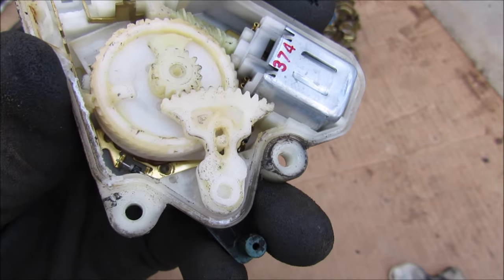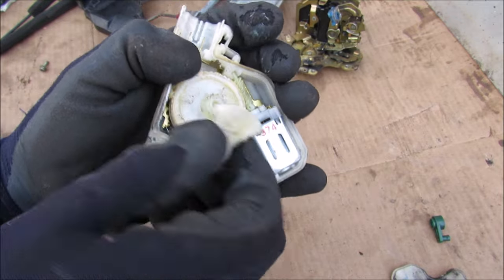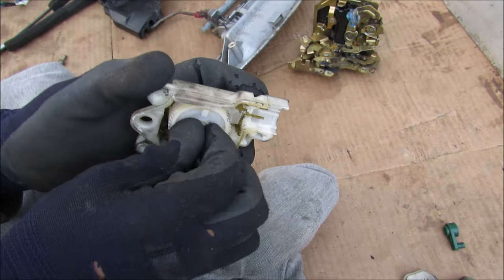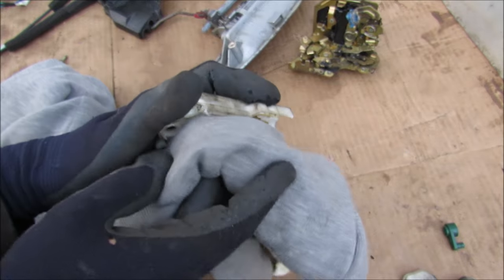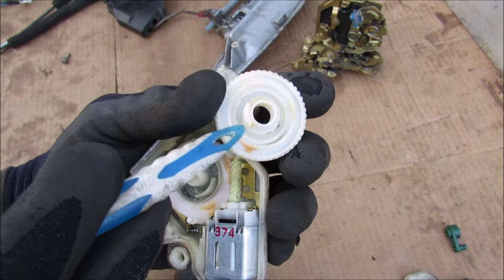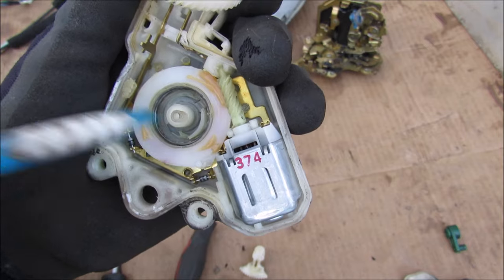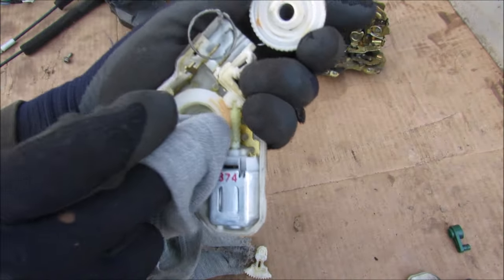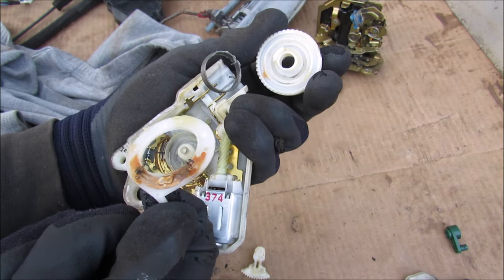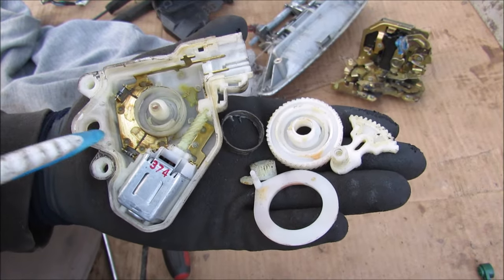Removing the screw holding the actuator, I can pop off the arm and pull out the quarter gear, revealing the arm that moves back and forth. After removing the small gear and wiping up the grease, lifting off this gear reveals a little spiral on the inside and a tab on the bottom that engages with a spring for self-centering spring pressure. Further underneath the spring is a spring retainer - and surprisingly, there are actual electrical contacts underneath. There's so much grease in here it's unclear how these contacts even conduct. This is a puzzling design choice compared to using a simple thermistor.